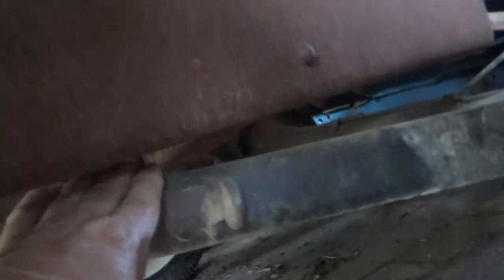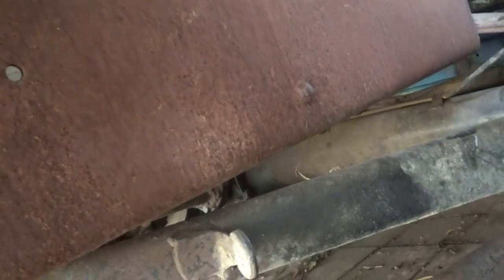The other thing that really stood out when I was out the front is the lack of clearance I have for the rear wishbones to the chassis — there isn't any. I can just fit my fingers in there, so it's not going to allow any suspension travel whatsoever. So I went through some other parts I've had kicking around and found some wishbones that mount on the Model A diff but mount underneath. When that's up to where it needs to be I've got tons of clearance, so we're going to swap those out. All I need to do is make a new mount on the torque tube where they bolt on — fairly easy to do. By addressing those couple of things it brings it to still kind of factory geometry, actually even better than what I've got, and solves my clearance issues.